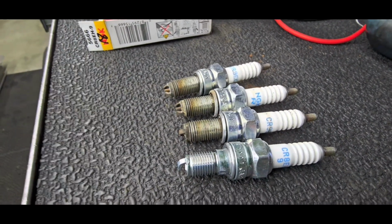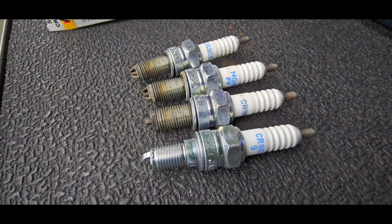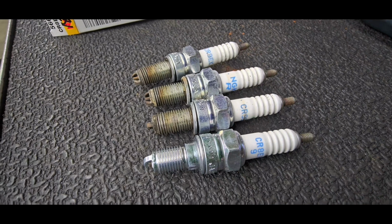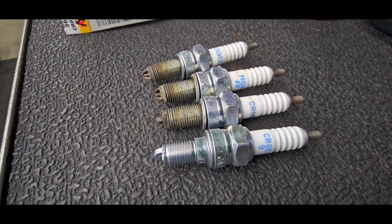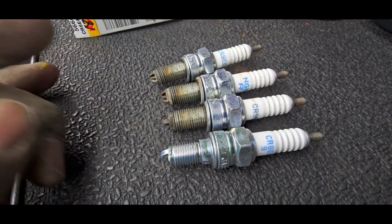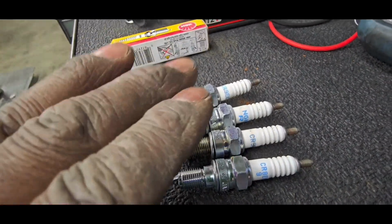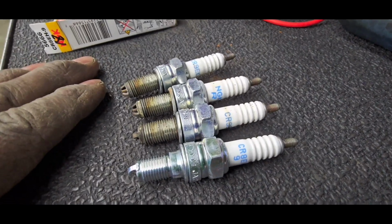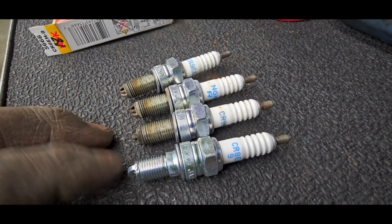The other mechanic's tell or tale that tells us why a spark plug is installed loosely is because the aluminum block hole to which the spark plug is installed is already buggered. A previous technician has already stripped the spark plug hole and therefore cannot install the spark plug as tight as it could be because it's just going to pull out the threads. So they very gingerly, very carefully screw it into position, and they're just like, yeah, just leave it like that, and that'll be that.